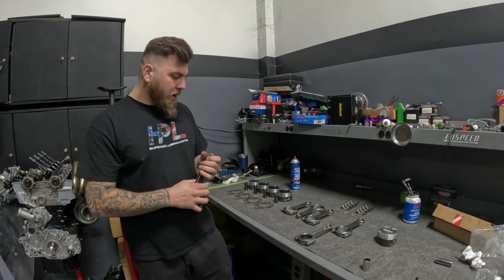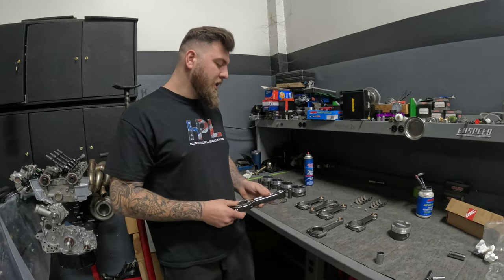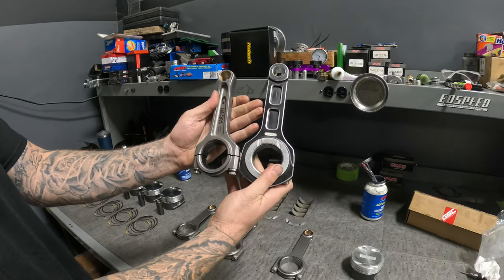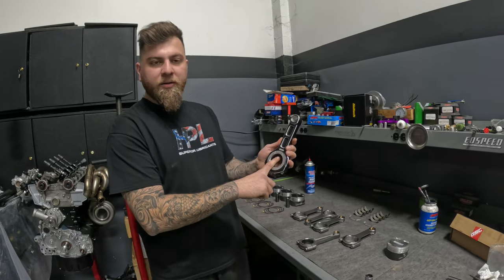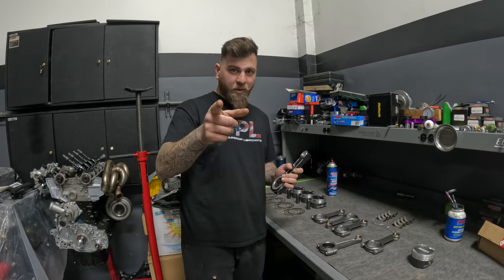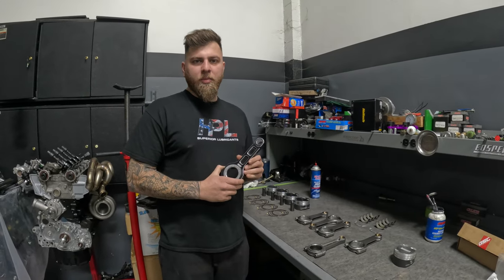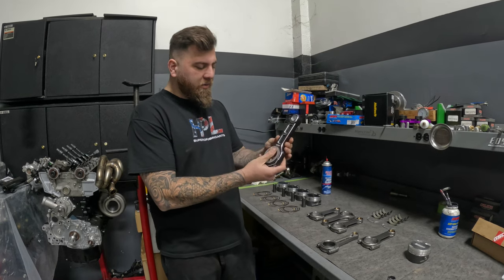Now the benefits of an aluminum rod and the cons of an aluminum rod. The benefit is it's about a hundred plus grams lighter — usually 150, 180 grams lighter — and it's aluminum. You guys can see it's extremely bulky, and that's to make up for the actual integrity of the rod. They're extremely bulky compared to the steel, but this is about 680 or 690 grams, and this is only like 550 — I believe the Vader rods, these are the V1s. He came out with the V2s which had improved pin oiling, and now there's a V3 which we already have. Essentially what this does is it acts like a shock absorber, so the power you're making gets absorbed by this rod itself because of the material.